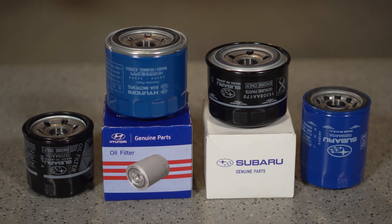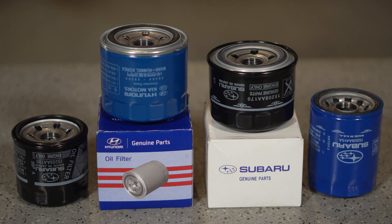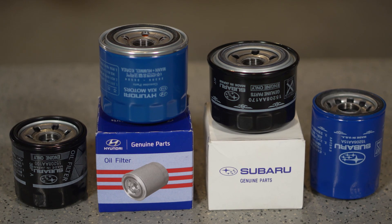We have a new gasket on oil filters because the OEM manufacturers want to protect their engines and prevent leaks. Today's engines have much tighter tolerances and they're using much lighter weight oil. So in today's filters there is a difference in seals — filters work the same way but they have a different seal.